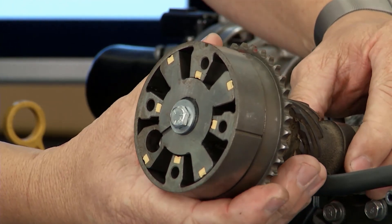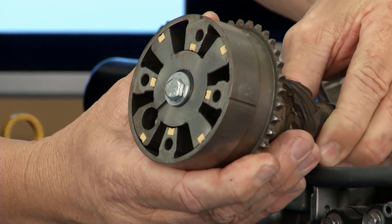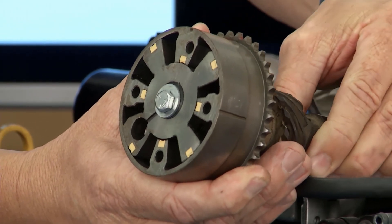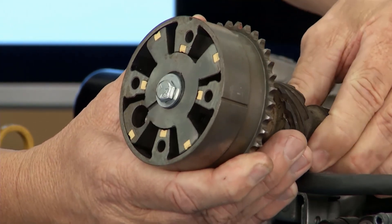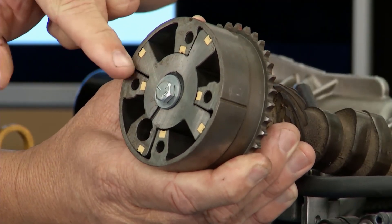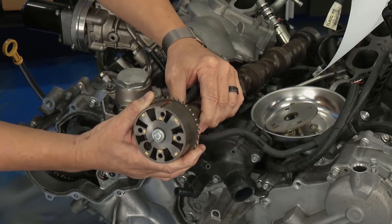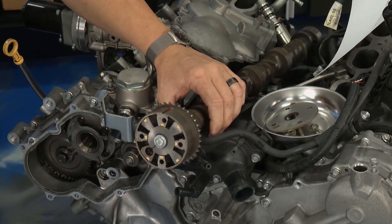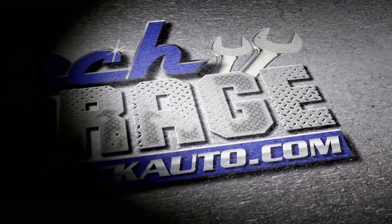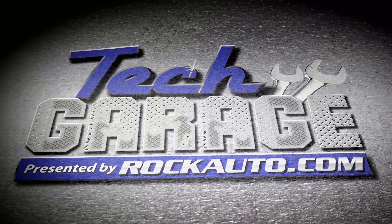Check this out — I have one out of a car. If I take the front of this off, I'll show you how it works. You can actually see the little vanes and the wipers in here. If I hold the timing chain and move this to the left or the right, the camshaft's moving but the timing chain is not — it stays the same. If it injects oil on this side, it's going to push it in this direction; if it injects oil on the other side, it goes the other direction. Optimal performance, optimal timing — but oil is key. There's plenty more Tech Garage presented by rockauto.com. Stick around, we'll be right back.